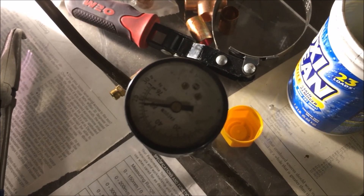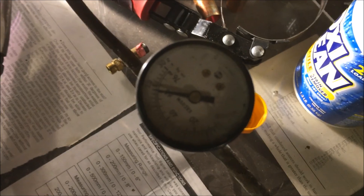Remember to flick your gauges too — sometimes these gauges stick. If you want to get an accurate reading, just give them a little flick. One of those 1960s scientists taught me that. Sure enough, sometimes when you do it you'll get another two degrees or two notches out of the gauge. So we're at 24 inches of mercury, which is a fairly decent vacuum for a free pump. You can go buy a $20 pump at Harbor Freight and it gives you 28 inches.